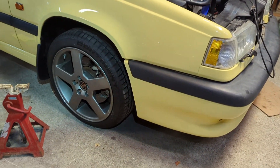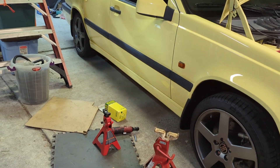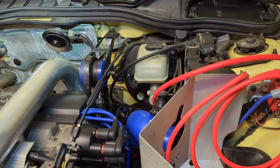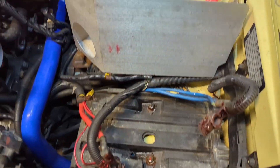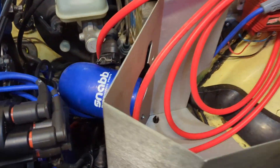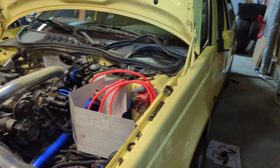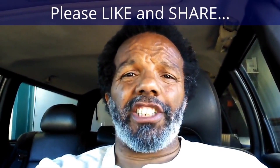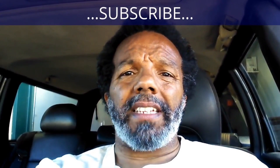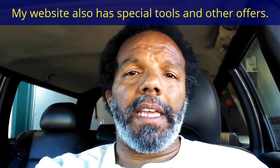Well folks, it is back on the ground. Torqued the axle bolts, torqued the lug nuts. We got two things to do when we get back — maybe three. We're going to put the fuel filter in. We're going to put the intake turbo piping on and the vacuum lines. We should be ready to fire this thing up and drop the battery in. We are down to the wire. If we would have had that mass airflow sensor too, we'd have fired this thing up and test drove it today, but we didn't. So we're waiting on the part — should be in tomorrow. If you feel that this information was useful, please like it and share it with your social media friends. You can subscribe to my channel so you'll get notifications of future videos. You can follow me on Twitter, and if you need to contact me directly, please visit my website. If you have any questions, leave them below and someone or myself will reply to them. Again, thank you very much for watching.